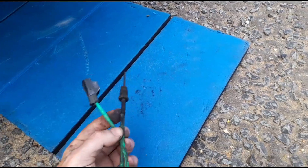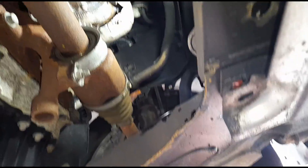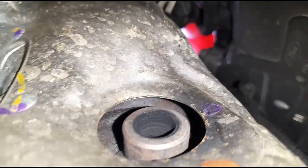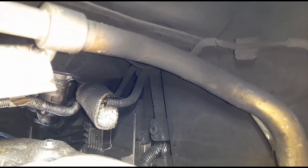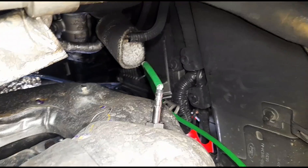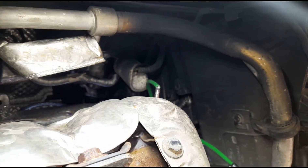I'm not going to test the old one — we've got a brand new sensor, so I'm just going to go ahead and fit it. I've tried to clean up the hole. I can't get my head up there but I can get my hand up with the camera. You can see threads in there. You can also see where it's been pushing exhaust gases everywhere — those hot gases could have melted wiring and caused more issues. The new sensor has bolted straight in with no issues — thread is all perfect. I really don't understand how that was left off.